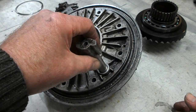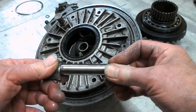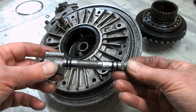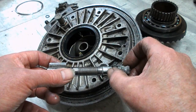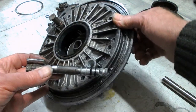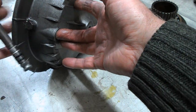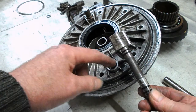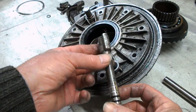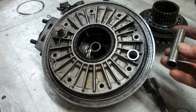On the inside it actually gets onto the drum, which is never a good idea on a brake drum. This is the standard spindle that came out of this unit, but on our customer's bike what we did was machine two new o-ring grooves in this side, not quite as deep as the originals, so there's a little bit more squish on the o-rings. I believe that cured the oil leak on that side, but unfortunately it didn't stop it leaking on this side.